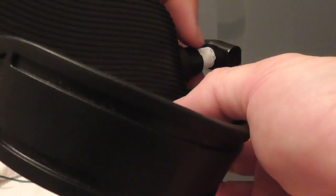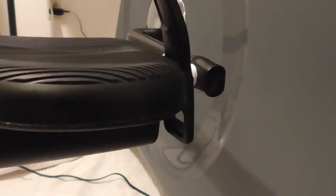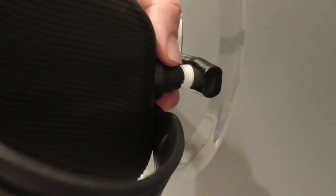And then you want to line it up, but you don't want to use a wrench. You want to screw it in with your fingers, make sure it goes in, and it does not cross thread. Try to get a better picture here for you. And then after you feed it in, and this could be the problem, you can see how wobbly and loose this is, but that's how threads are. They tighten up at the very end, and you saw that when I put on the tool, this came right off without any effort. I didn't even have to loosen it. So things are almost tight.